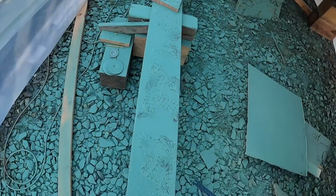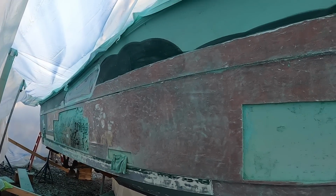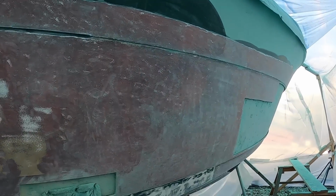They have all the surfaces ground and prepped. There's green dust everywhere, and they are about ready to start laying in new coring, epoxy it to the inner liner. There's a little more rot here to chip out, and then they will be ready to start putting Coosa in around through hull fittings where those rags are, and glass in all of the new coring pieces.